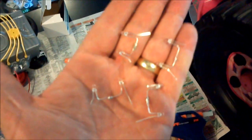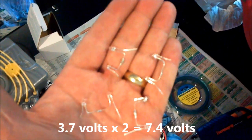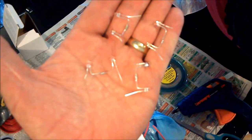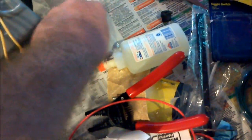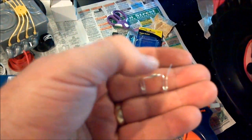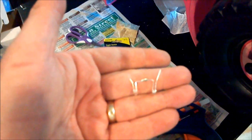I got two blues and two greens, and each one of these is actually made up of two LEDs because these are 3.7 volts per LED, and so to run six volts through them, you have to hook up two of them together, and I just soldered little pieces to get one of the connections together. Now when LEDs come, they have two wires — a long one and a short one. The long one is the positive and the short one is the negative. So I cut them so that this one is the negative and this is the positive, and because it's shorter, it's easy to tell. So I've soldered this positive and this negative together. When I hook up the wire, I'll hook up the negative over here and the positive over here, and then when it hooks up to the battery, it will light up and it won't burn out the LEDs.